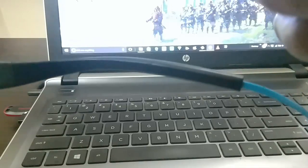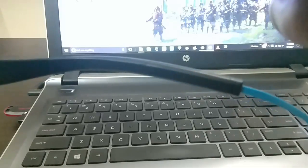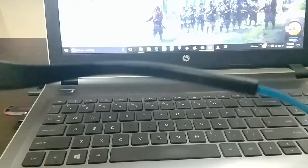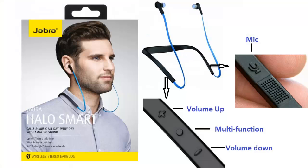Another attempt and it worked! This time I turn it on, get the green light, and keep the multi-function button pressed continuously. I'm still keeping it pressed — and there you go, I got the announcement: 'ready for connectivity.' So now I should be able to see these earphones in the Bluetooth devices list on the phone and connect without any issues. This way I can connect up to eight devices with these earphones.